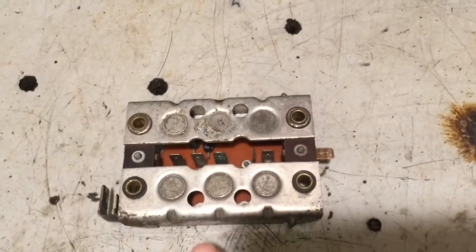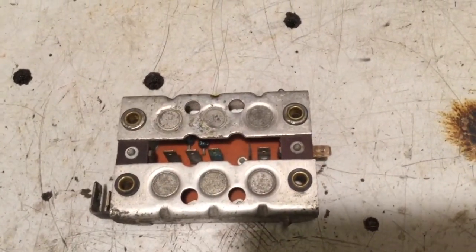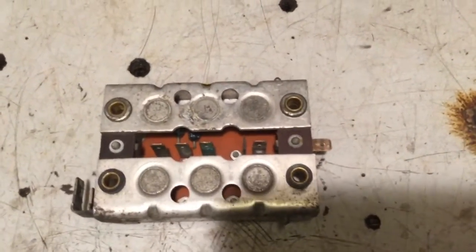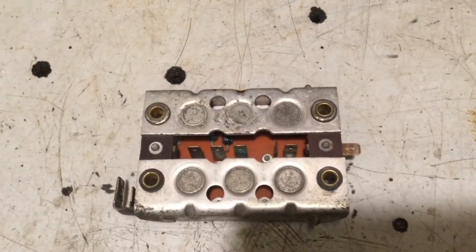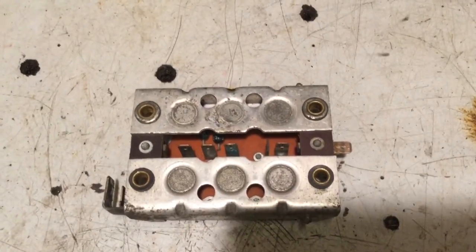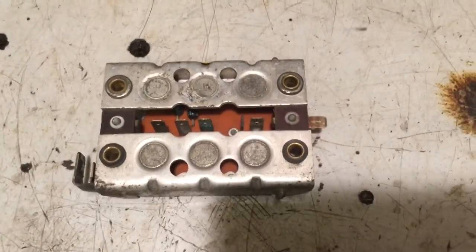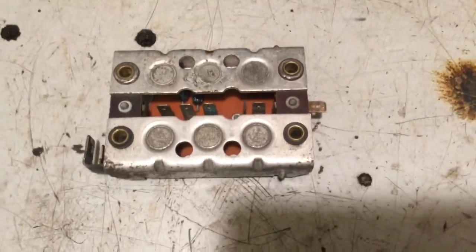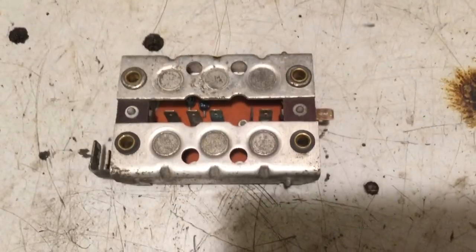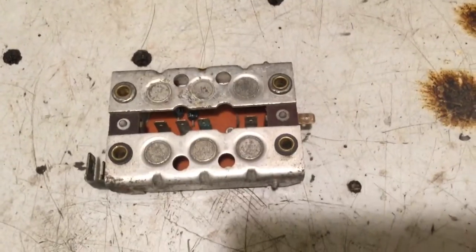This aluminium behaves as a heat sink to take excess heat away from the diodes as the alternator is charging. There are actually 11 diodes on these circuit boards; we're mainly concerned with the six phase diodes which actually rectify the current from the alternator. The alternator produces alternating current and this needs to be changed to direct current — you can't charge a battery using AC, batteries need a DC feed, and that's what the rectifier does.